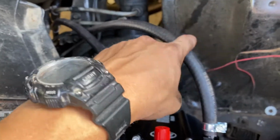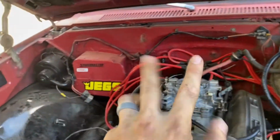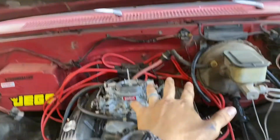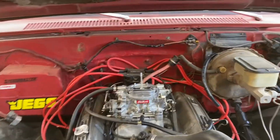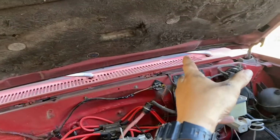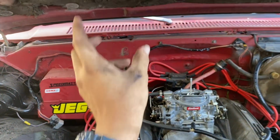I did actually hook up this guy. This is the return, and it is hooked up to the vent. Now I forgot, this thing has saddle tanks, so there's one on this side and this side. So the vent, I believe, has a T in it, which goes over to whatever side. Now the problem is, if I'm running this thing on this tank and it's running good, I would usually just say, oh, it's fine, let it split between both. There's one issue. The big issue is this tank works on the driver's side. On the passenger side, it leaks out profusely, apparently. So we'll have to disconnect the T and just hook it up to the driver's side, at least for now, until I fix it. Once it's fixed, I can actually just take the vent one and hook it up to the old return line system.